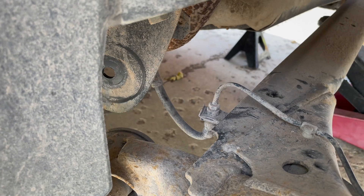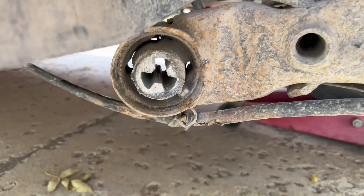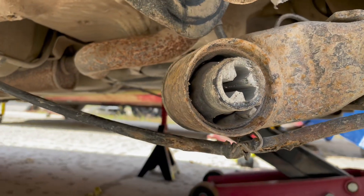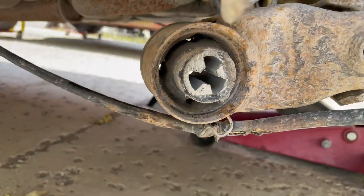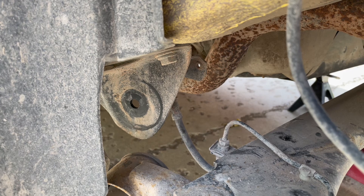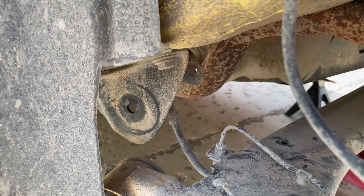I can't get the brake line off — I think I might have broken it too, so we'll see. I got the bolt off and lowered. I did both sides so it can just fall down so I don't have to take the whole bracket off. I did that because the lines are hooked to the bracket and I can't get the line off.